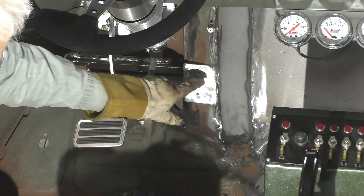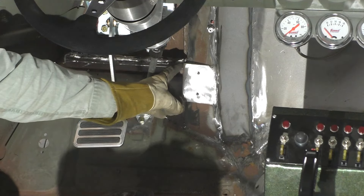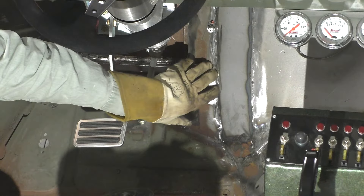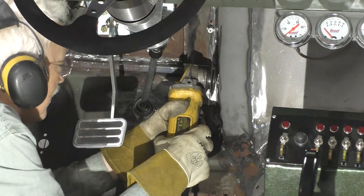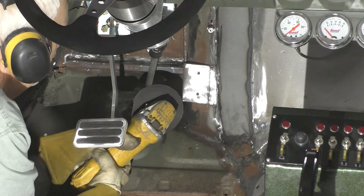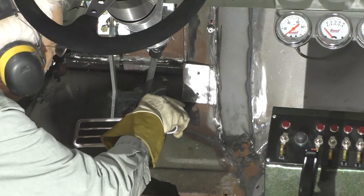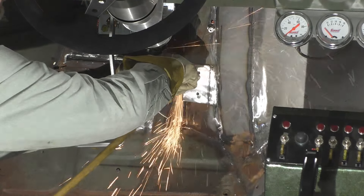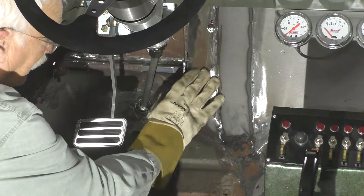What we have to do is cut some of this old foundation out for the old gas pedal. I'm going to leave the side here because I can use that to tack to put the new one in, but I'm going to cut the front off. I can't get in here with this tool, so I'm going to have to use the air cut-off wheel to get in there. And now we have a place to put our new base.